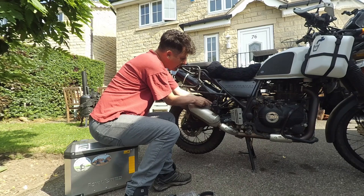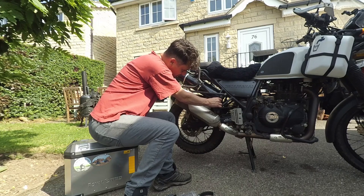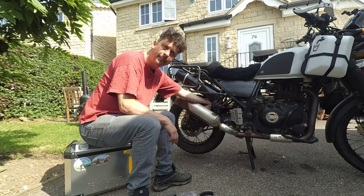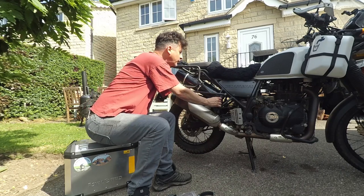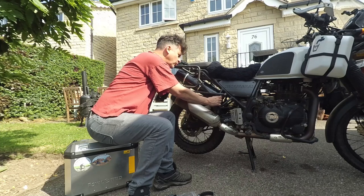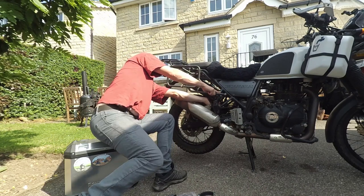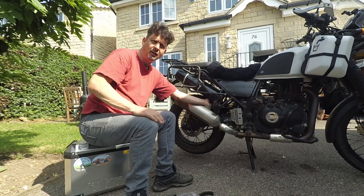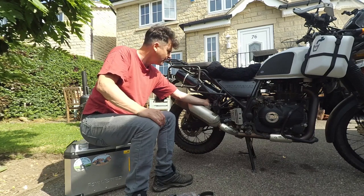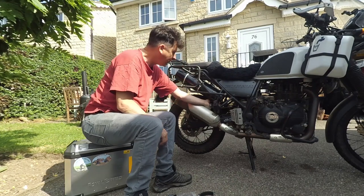The reason is they were kind of slipping — or at least the other one was slipping forward and bashing into the chain guard. So I'm planning on putting an extra one there in the hope I can attach it to the frame. My concern is how close the inside is going to be to the wheel as the suspension compresses, but I think it's alright. It'll end up with three pipe clips.